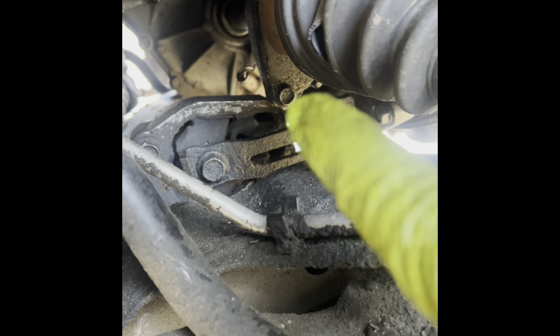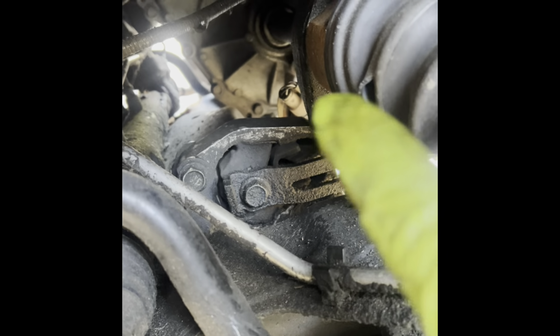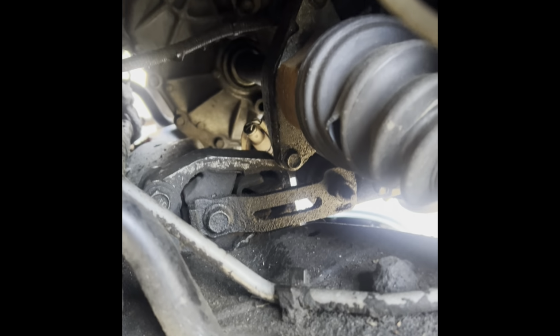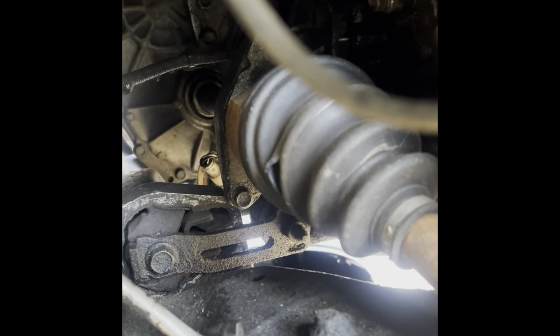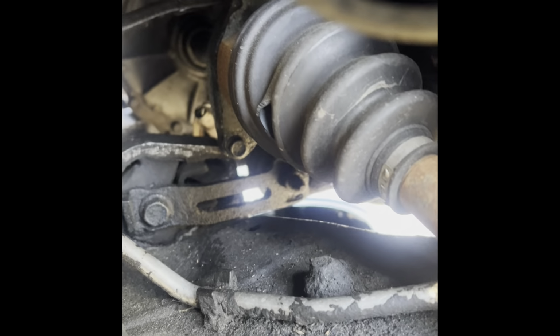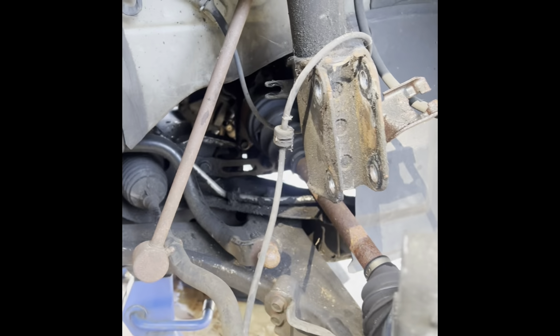We're back. The axle's out of the spindle. But before I do it on this side, see that bolt right there and that bolt right there? I think it's two. You gotta remove that, and that would allow me to remove the steer rack, the CV joint. I keep on saying steer rack, so. CV joint. I guess it's a retainer for the seal, maybe a protector. Not sure, but that has to come off. 12 millimeter heads. So I'm gonna get that off, and I'll remove the axle.